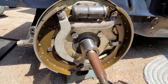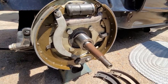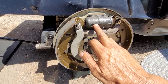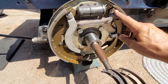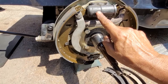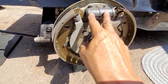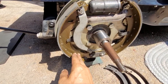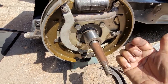I wanted to touch on one more thing about early Ford brakes. If you have a big piston and a small piston, the big piston goes to the front — and unlike modern stuff, the big shoe goes to the front too. Big shoe and big piston to the front, small to the back. That's opposite of what we do nowadays, where we might have the same size piston but a short primary shoe and a long secondary shoe.